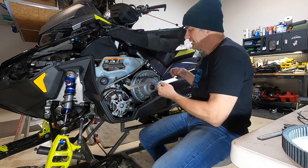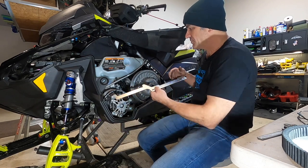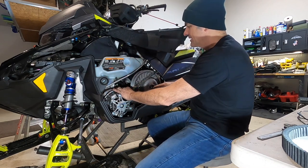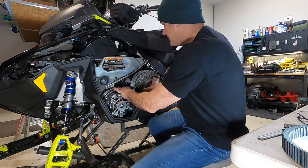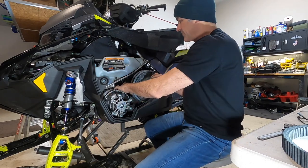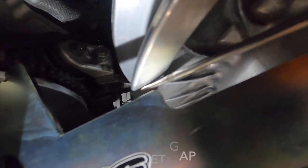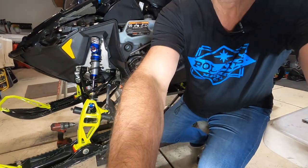We've got our TRS alignment bar for the P22 clutch or the P85 clutch. This is how the sled came from the factory. If we put our alignment bar in here on that P22 clutch, the front part of this bar is supposed to be touching the secondary sheave — and I've got a significant amount of room in there. You can see this part of the bar is supposed to be touching my clutch, and I've got a huge gap here. So my offset is way off, and I've got an even bigger gap in the back. My lead-in and my offset from the factory are hugely off.